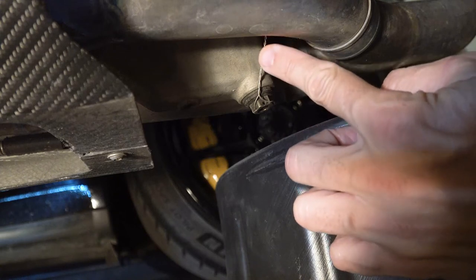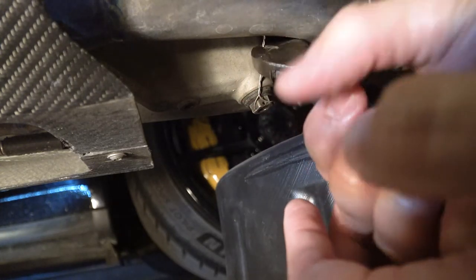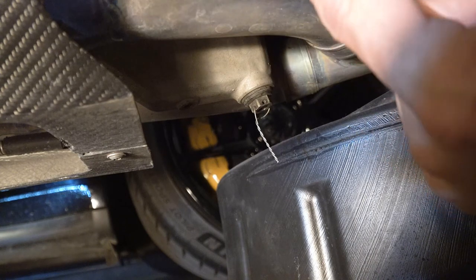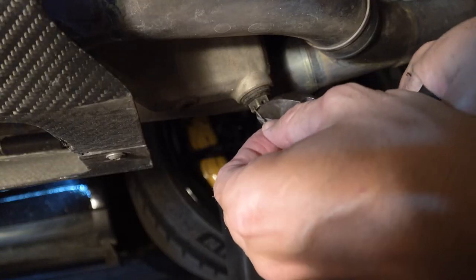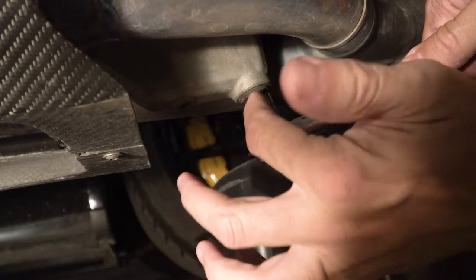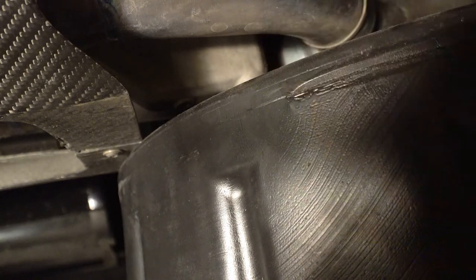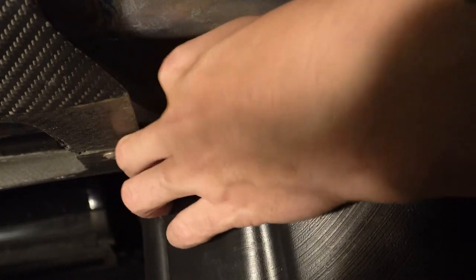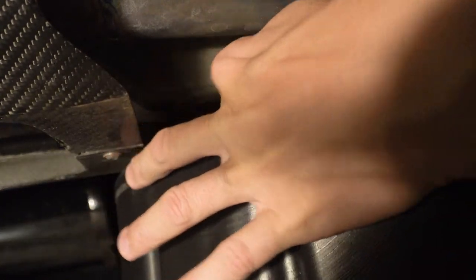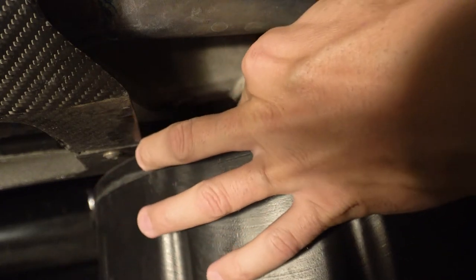This particular bike has safety wire on the oil plug per the race rules, so the first thing I need to do is snip that wire off. If for some reason you forget that you just had the bike running, the exhaust or something else hot will soon remind you. This bike takes a 14mm socket on the oil plug — each bike may be a little different. I try to get it broken loose with the wrench first, then make sure you get your drain pan under it. Don't lose the plug into the bucket, and don't make a mess on your floor. Keeping the rear end on a stand will help give you a little more clearance if you have a high pan like this.